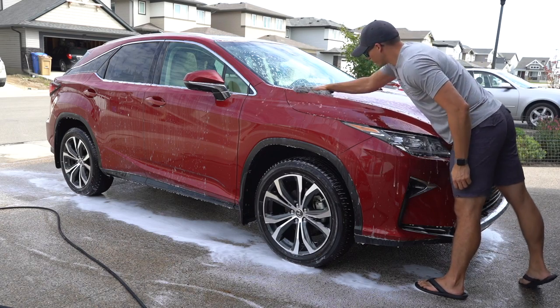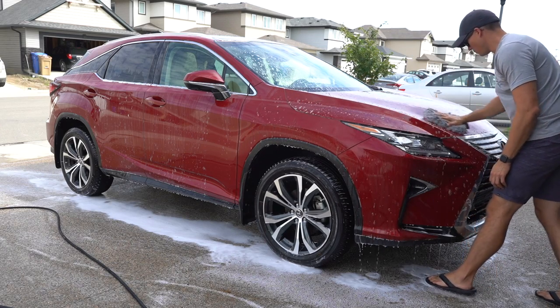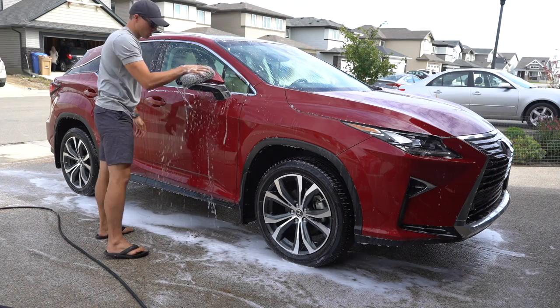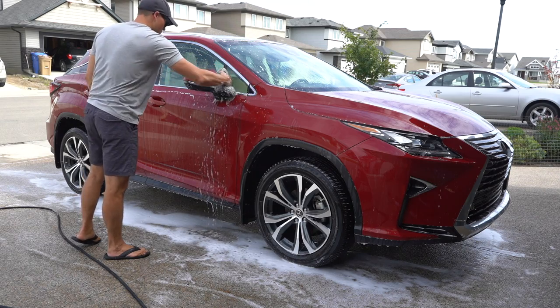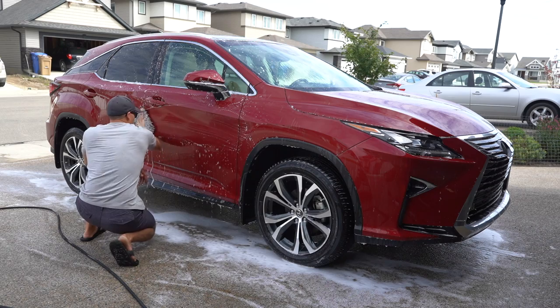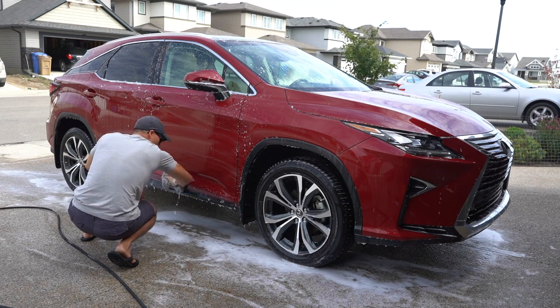Now, since the swirls in the paint you saw in the opening were caused by improper washing techniques, I figured I would go over what the proper way to wash a vehicle is, and that's first off using the two bucket method. So what that means is having one bucket with soapy water and one bucket for rinsing your wash mitt, and you should also have grit guards in the bottom of each bucket. If you guys aren't sure what those are, I've got links to them in the description for you.